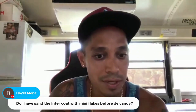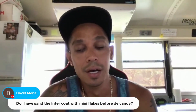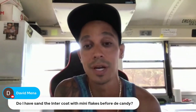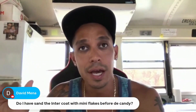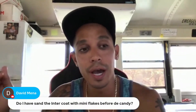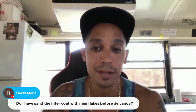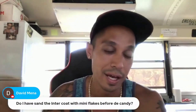Is this making sense with mini flakes before the candy? It depends. I actually have a step-by-step video coming out on the Honda Elite moped project where we did sand because I was using a larger flake. If you're using a larger flake, it's going to feel pretty bumpy and rough. You could go ahead and use some 800 grit or 1000 grit to scuff the high edges down a little bit before you put your candy on top of that, or your clear coat concentrate with candy inside of it.